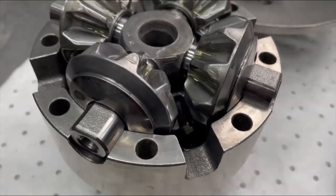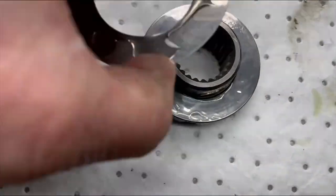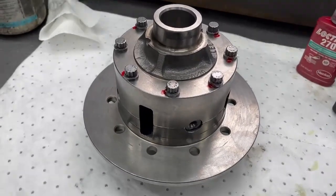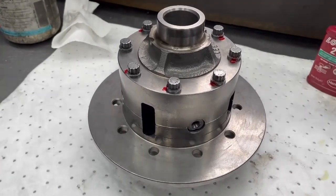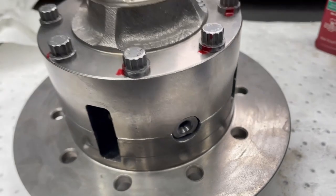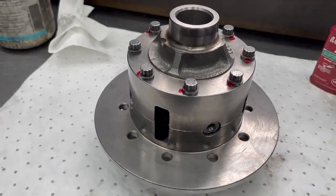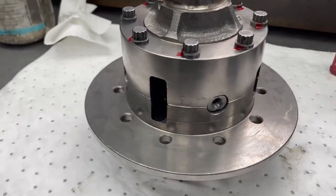We've got the bottom gear in place, all the thrusts on, a nice bit of oil, and the forged cross shaft in there. We're going to put the gear and the thrust shim in, pop the top on, and bolt it all up. One upgraded 110 TD5 rear centre with forged cross shaft — everything cleaned, repolished, put back together. Bear in mind the forged cross shaft here is 18mm. The early TD5 110s and P38 4-pins — Land Rover cut costs even more by trying to fit a 16mm cross pin, which is just hopeless. We can only upgrade the 18mm ones.